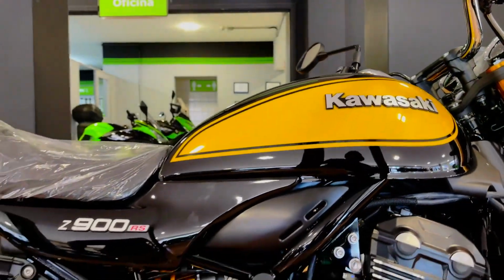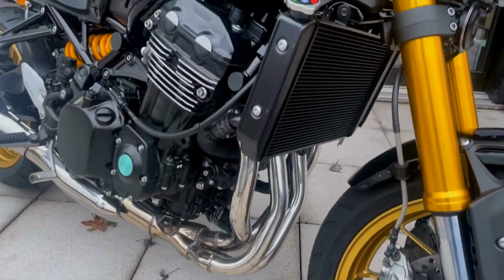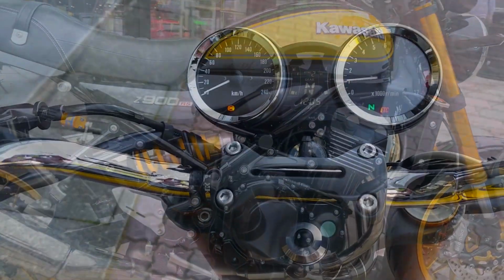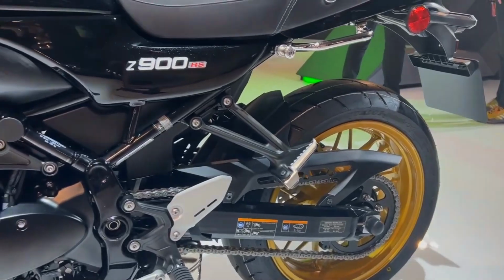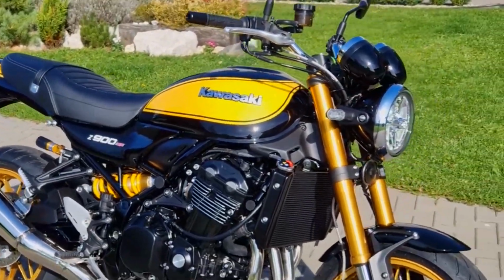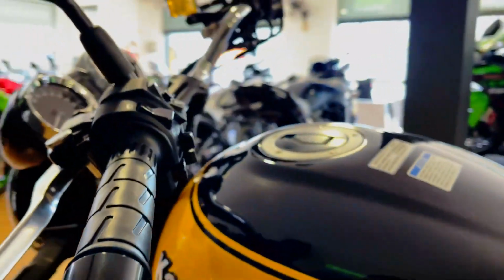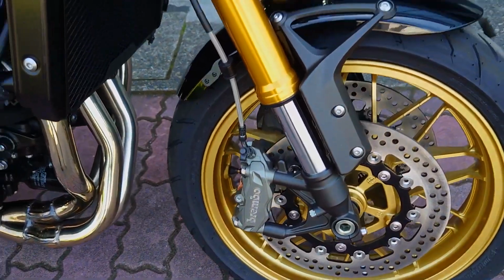The Z900RS SE comes as standard with yet another astonishing variety of quality spec enhancements, including modifications to suspension and brake components, which is again evocative of the type of tweaking fans have previously done. The SE versions include an easily accessible Öhlins S46 rear shock with preload adjustment at the back of the vehicle. Superior grip and handling feel are provided by the aluminum body's single tube structure, a big 46mm piston, and internal oil and gas chambers that are divided by a floating piston.